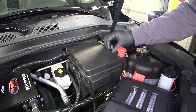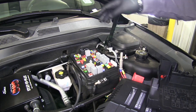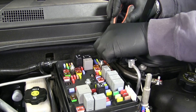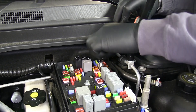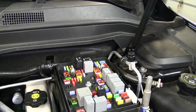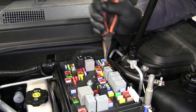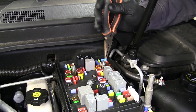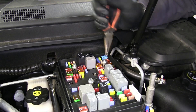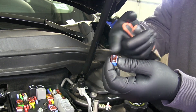To remove your cover, you're just going to push the two tabs in and pull it off. The one we're going to be removing is the ABS module fuse, which is this one right here on the end. We need to pop this cover off. This fuse is going to be a little bit hard to get out. It takes a small needle nose pliers — reach right down in the corner and just work it out. Then we'll be installing that back into our fuse holder.